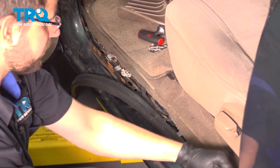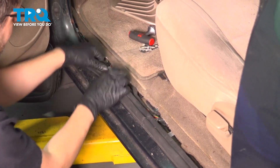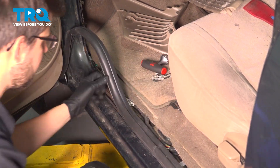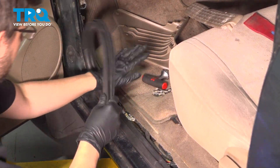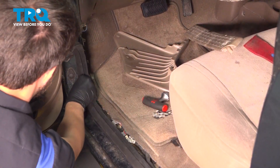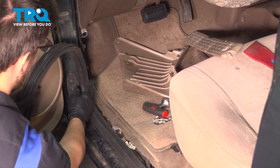Having said that, just start pressing the seal down. You need to make sure that it bites onto this lip here, this edge. If you just tap it with your hand, it should lock in pretty tight, as you can see. At this point, you just run around the entire perimeter and tap it in place. Around the curves and edges, you want to make sure that you push it down into place so that it's not cutting the corner short.